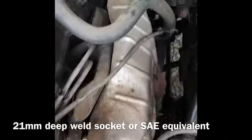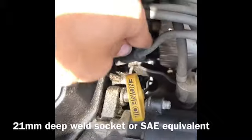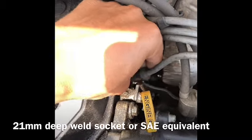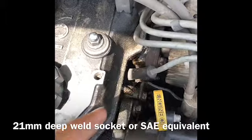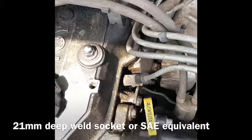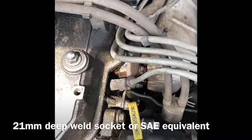Basically, you just take these right here and pull them — try to grab it here and try not to damage the cable. Just pull; it'll unplug. Then you put your deep wall socket in there, reverse it out, put your new one in. They recommend right around 20 foot-pounds of pressure when you tighten it back up, then you pop the boot back on.